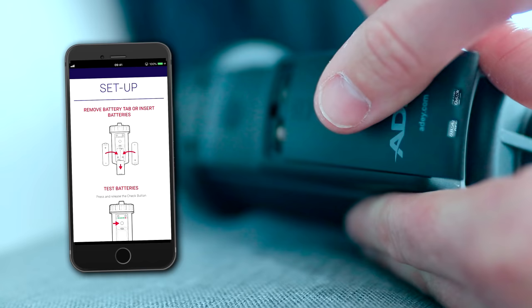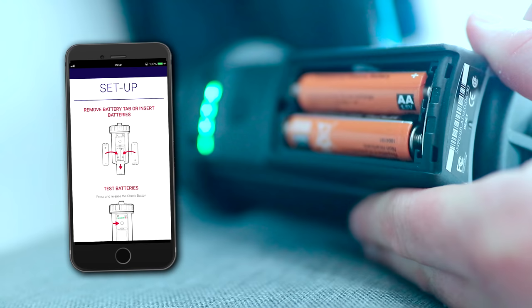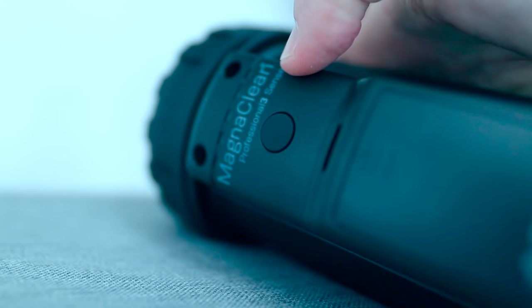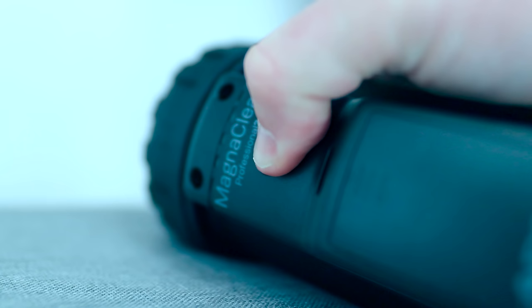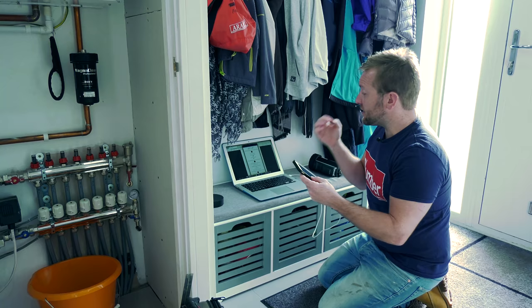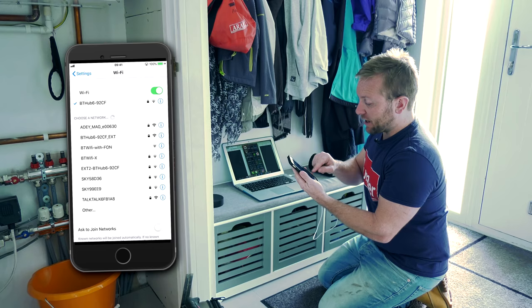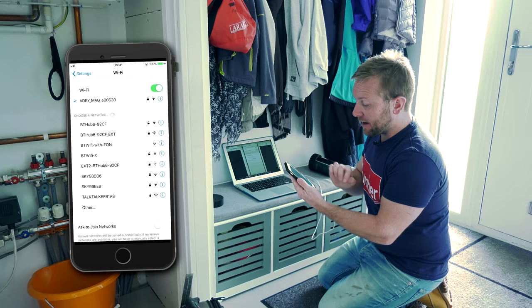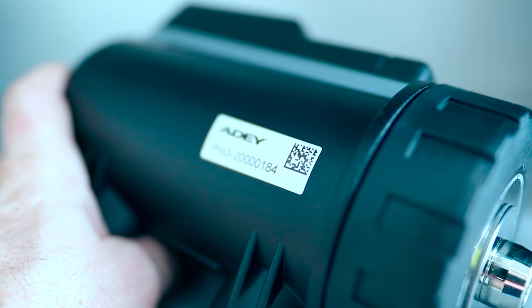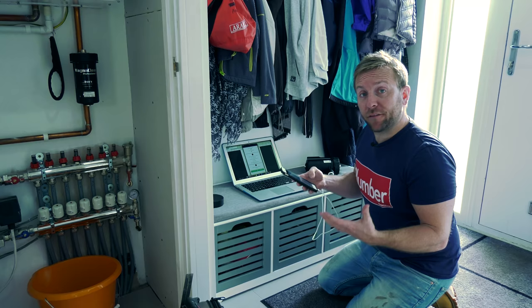Remove the battery tab or insert batteries — which you'll just see here — and that will bring this one to life. Look, we've got lights and everything. Now we press the check button for six seconds until the green LEDs flash twice. We're just following the instructions — this isn't hard. That's it, we're in. I now press next on the app, go to my phone settings, and now I'm going to look for our AD filter in the Wi-Fi. There it is — AD mag. The password is located on the side of the filter itself — it's case sensitive. Now we pop back to the app after the connection's established, press next, and look — we're now actually in the filter.